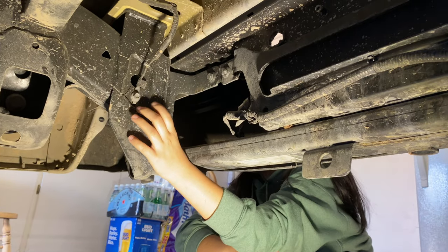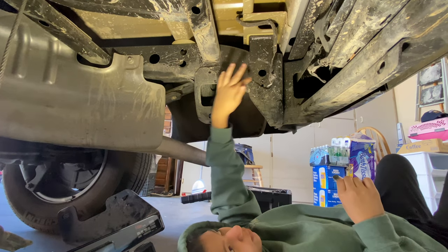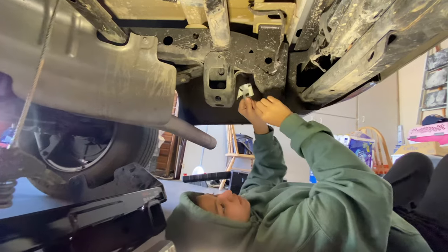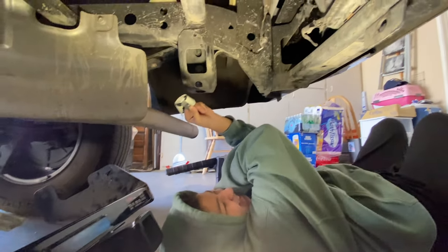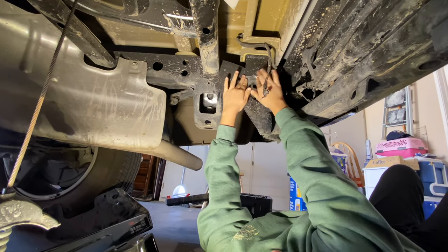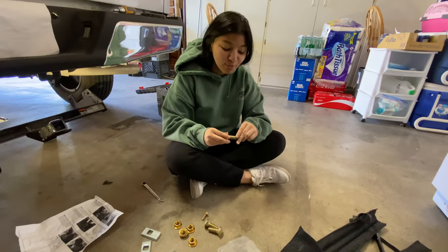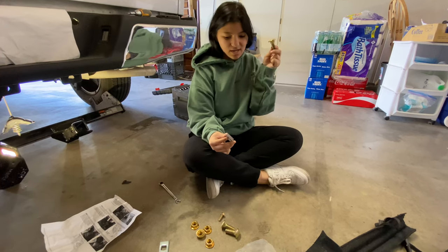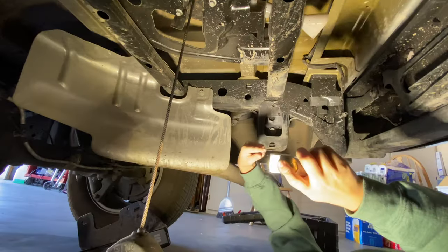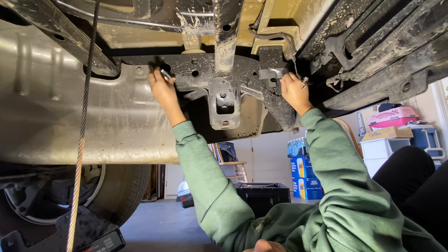The next step is to remove this ground wire right here — this screw is a 10 millimeter. You're going to be attaching the hitch to this front hole and this back hole over here. Tape the U-washer to the first hole in the front, like so. Make sure your head's not directly below it. Screw the bolt on the wire, take a washer and feed it through the other way, then feed this through under there. Stick the wire in the big hole. You gotta push the washer in first — you can't put the washer and the bolt on at the same time.